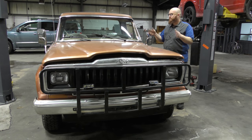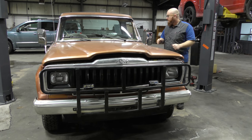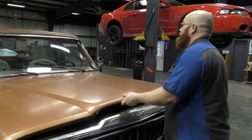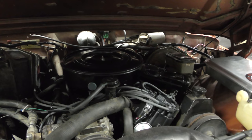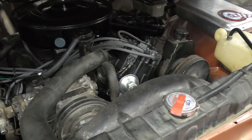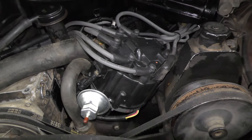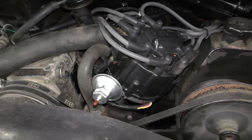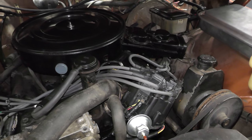This one came in - the customer had most of the fuel injection setup installed himself, but like I said in the last video, he had back surgery and it just prevented him from going any further. He didn't want a dead vehicle sitting there, so he brought it here to let us finish it up. Let's take a look under the hood. The distributor looks out of place and that's because it's basically an '80s General Motors HEI that you would find in an '85 Chevy Blazer or half-ton truck - it's been converted over to that. Underneath this air cleaner is a General Motors throttle body injection unit.